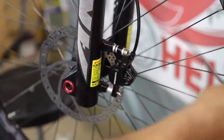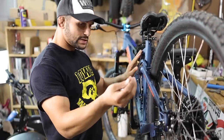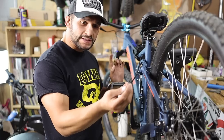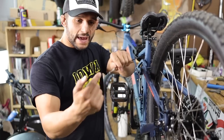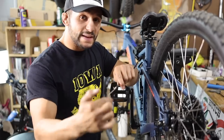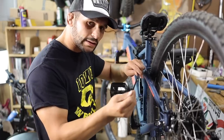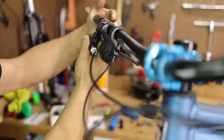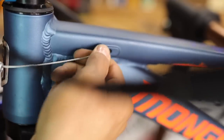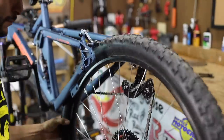What I'm thinking is getting this cable and pulling the housing outside while leaving the cable inside. That way I can wrap this cable around the hose of the Tektro hydraulic brake after we cut it, wrap some tape around it, and then pull the cable through. We're going to daisy chain it. Let's go ahead and undo this stuff up here. We've got to take that rear wheel off and change the rotor out, and then we'll get after it.